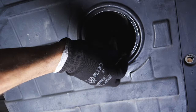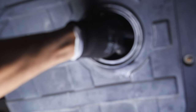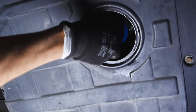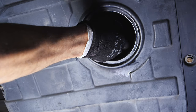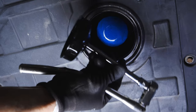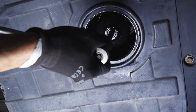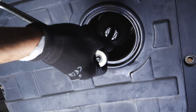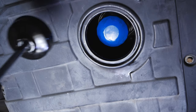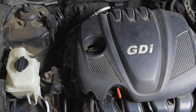We want a nice clean mounting surface for our oil filter, especially the rubber seal, so it gets good clean contact and we don't have to worry about dirt causing leaks. We're going to screw the filter in hand tight — you don't want to use any type of tool for the initial threading. Screw it in hand tight as best as you can, then take a ratchet with the filter cap and give it a quick snug — not even half a turn, just an eighth of a turn or so. Some people say hand-tight alone is fine, but just a little snug with the ratchet won't hurt.